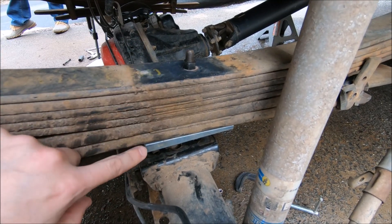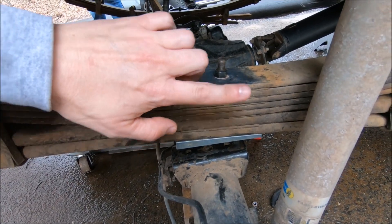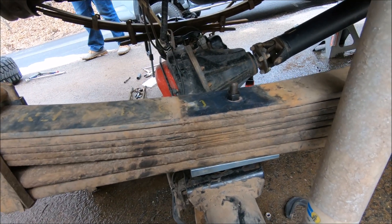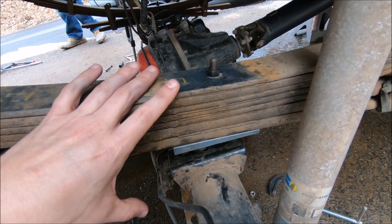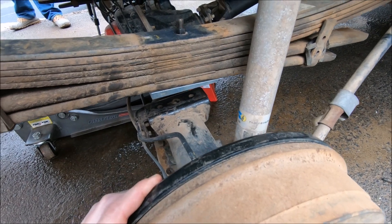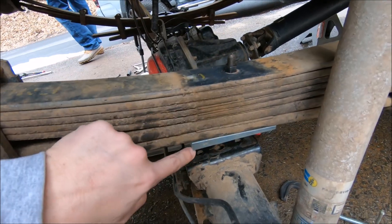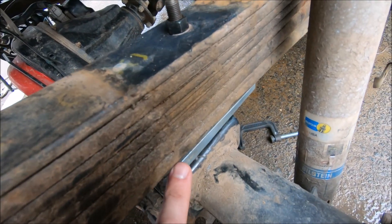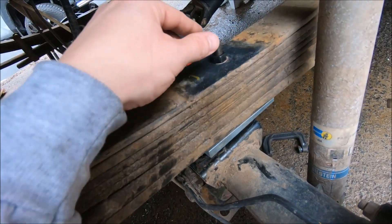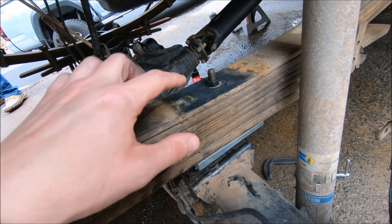You get the replacement center pin through the bottom of the shim. Make sure you have the fat part of the shim towards the back of the truck and the skinnier part towards the front — this will help rotate the diff so it's in more of a stock location and hopefully alleviate any vibes. Be careful not to pinch your fingers; if you need extra room, have a buddy tip one side of the axle to get a seesaw effect and get it in there. Get the top bolt hand tight and make sure the plate is as parallel as possible to the leaves on either side. If it's cocked one way you can use a hammer and center punch to align it, then raise the axle back into position and get everything torqued down.